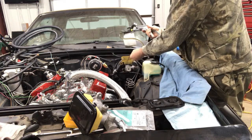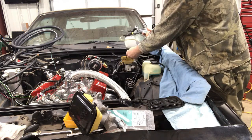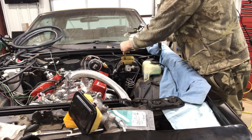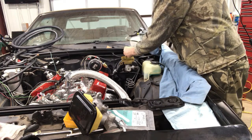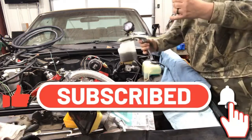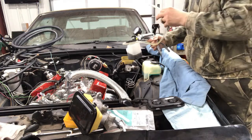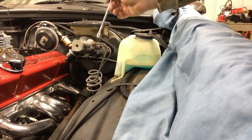What you don't want to do is get brake fluid on your paint — brake fluid will eat the paint off of a car, that is not good. You'll notice I've got a fender cover here and I'm holding the tube down in the reservoir, being very careful not to splash it. This vacuum pump is also used for many other applications — it's got a pressure switch on it, so make sure the pressure switch is turned to vacuum so you don't blow air through there. I'll put the cap back on to keep any fluid from splashing out when I take these lines loose.